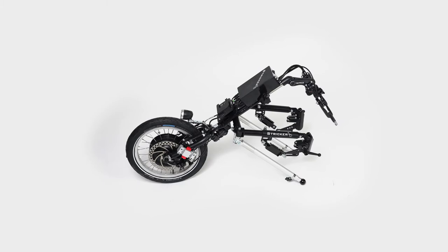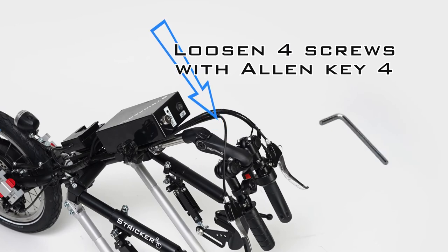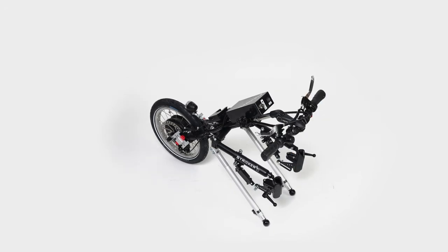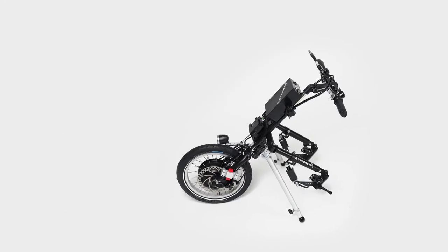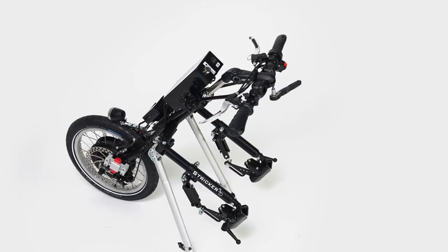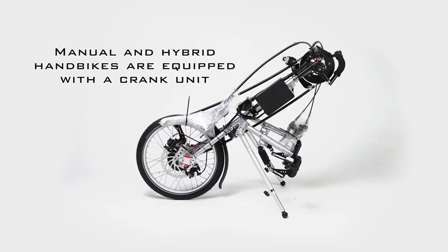If we are shipping electric power devices, we fold in the two handlebar arms for shipping. To bring them into the correct position, first loosen the four screws with the four-millimeter allen key and then unfold the handlebar arms, then tighten the screws again. To change the angle of the handlebar arms, loosen the screw under the handlebars with the five-millimeter allen key and choose a suitable angle.